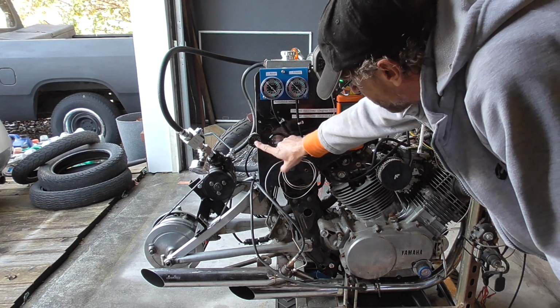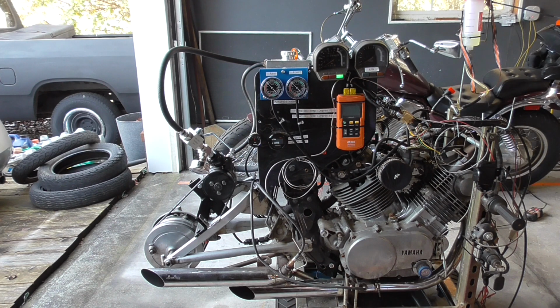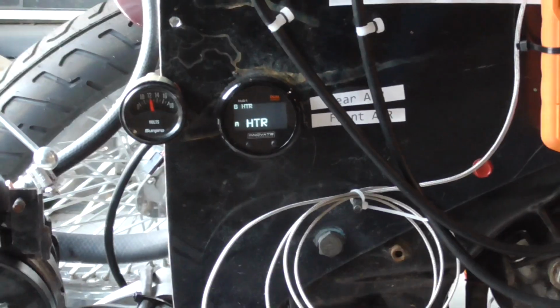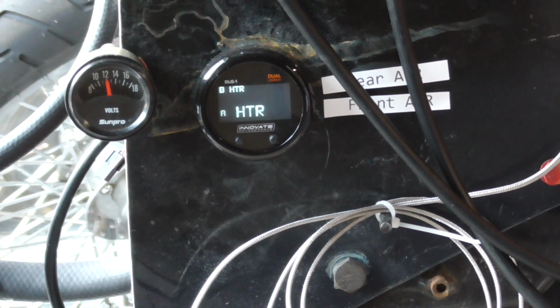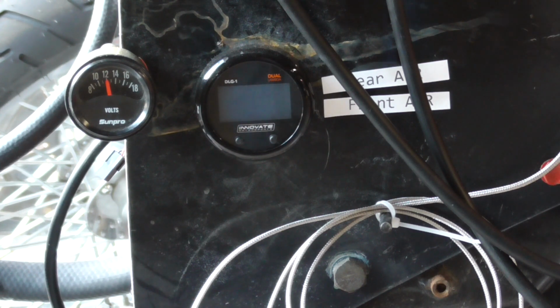And I got a voltage gauge right there that shows I'm at 12 volts, but what it does is it goes E9, E9, and it resets that heater all the time. So I'll zoom in there and you can see when it's first coming on, it says heater, heater, but then periodically it'll blink E9. So let me walk around this thing and we'll see how it's installed, and then we'll show what we did to fix this thing.